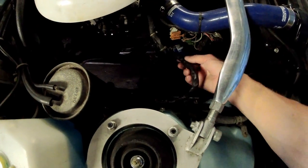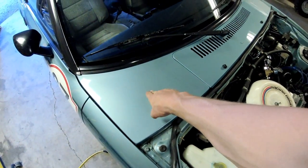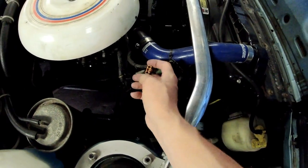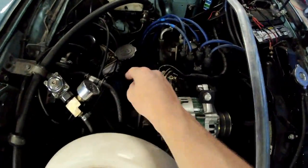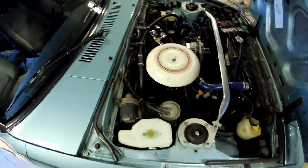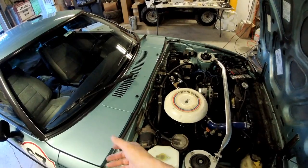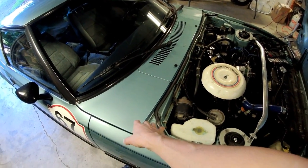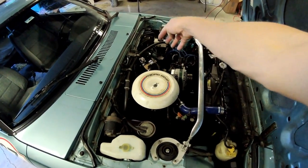There's an emissions harness coming from a small ECU under the floor — on an 84–85 car this exists, while earlier 78–80 models may not have it. This harness has assorted colorful plugs for a small TPS, vacuum solenoids, etc. My plan is to strip back this harness and pull a lot of the wiring out, though I'll likely need to leave the ECU in the floor because the sensor wires for the gauge cluster — coolant temp and oil pressure — are routed through this side of the car.